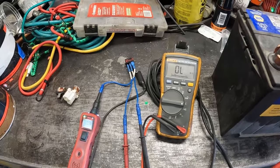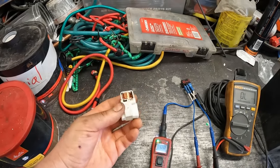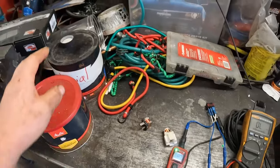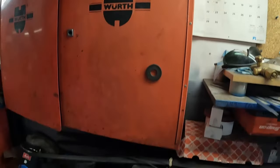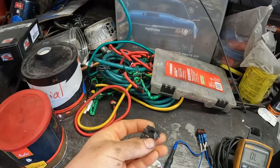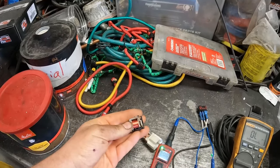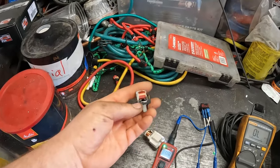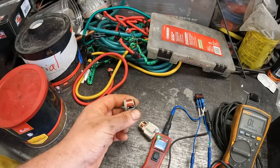Enough about that. For this one here, it was just a matter of the relay. I just grabbed another one like this, of course, one that was good, and just ground off the 87A. It got the vehicle going for a day or two, and then they came back a few days later. We popped the original, the proper relay in, and everything has been hunky-dory since.